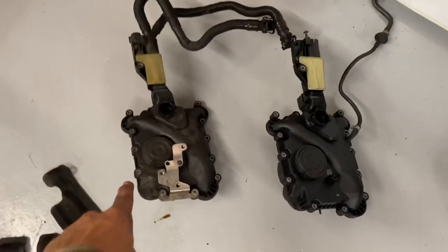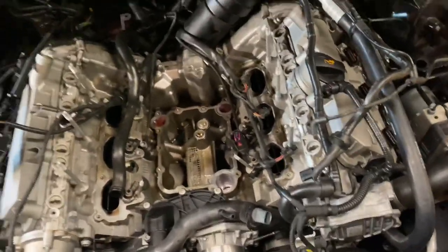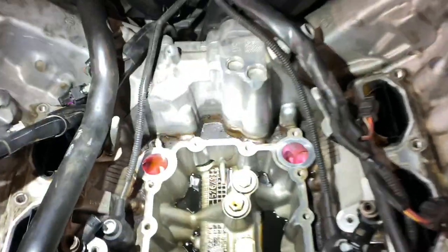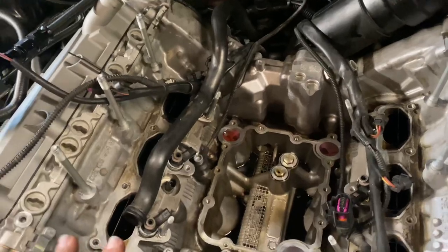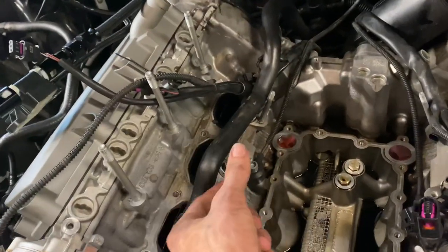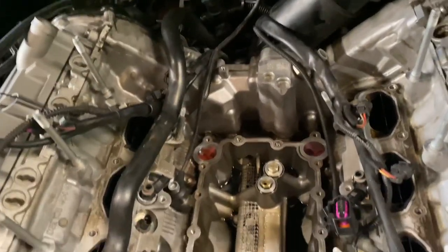Got another little update — PCV is out. Ended up just pulling all the hoses out with it. This is the old one, this is the new one. Now I'm going to get cleaning in here. People overcomplicate this job on the internet so much — they say you're going to break this coolant tube. Dude, take the extra five seconds, be careful, just wiggle it this way and this way and it slides right out. Just don't disconnect it from back there, just move it out of your way, slide the new thing on, put it back where it's supposed to be. Just be careful, it's not difficult. Don't overcomplicate stuff. New thermostat and new water pump are in. New gaskets — not new hardware since it didn't come with hardware.